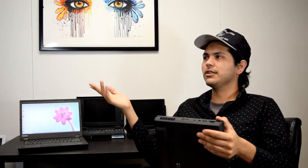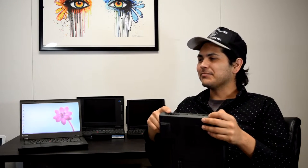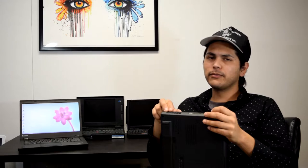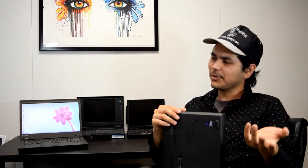Windows 7 would probably work flawlessly. Both units have Windows 8 embedded COAs, though this one probably got upgraded to Windows 10. Upgrading the screen is probably essential on the P models — you can see in my other video where I did the screen upgrade and it is so much better. It's a direct swap for P and S models, but the regular T440 cannot do the panel swap.